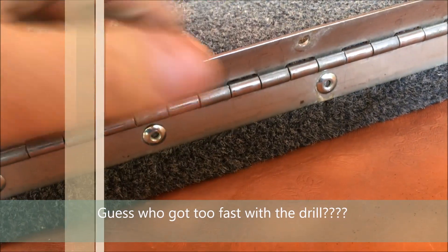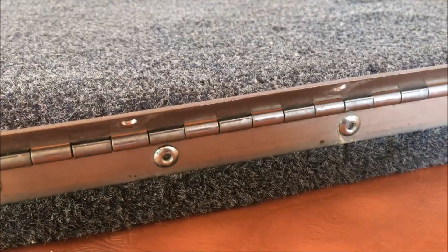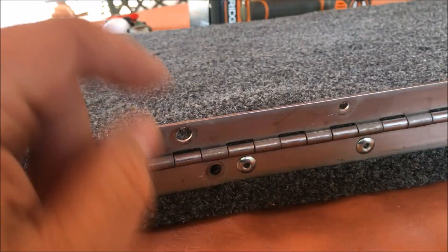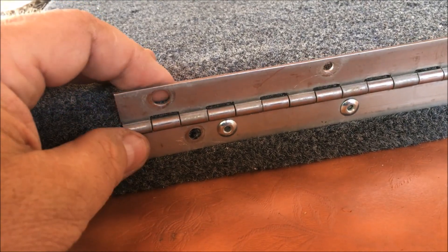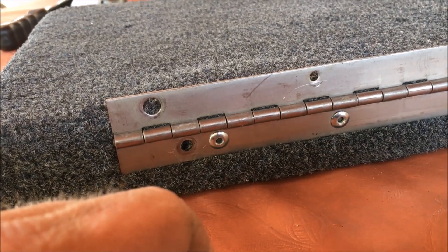I just wanted to come back a second. I put together these videos to try to share stuff as I'm doing it, hoping it'll help somebody, but I want to be honest — I'm no pro at this and I figure things out as I go. I did mess up: I got a little spot in my carpet because I wasn't paying attention when trying to drill out a rivet and let it touch there and it ripped part of the carpet. Also, when drilling out one of the rivet holes I bored it out a little more than I should, so the rivet wouldn't work there. But you can work around it — just drill a hole big enough elsewhere and pop another rivet in. It's looking fine.